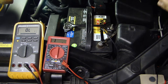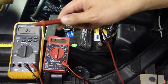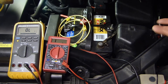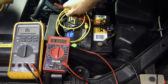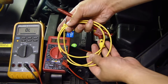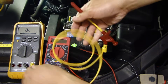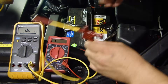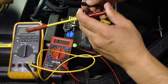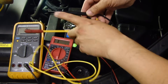You've got to make sure that when you're testing the continuity from one probe to the other, there's no huge amount of resistance. Or let's say you're testing a wire inside the vehicle to see if it's a good ground — you can use a piercing probe like I showed you in my last video. Unplug one of the probe wires, plug this one in here, and then you can test the continuity between this piercing probe — connected to the wire you're testing — and a grounding point.